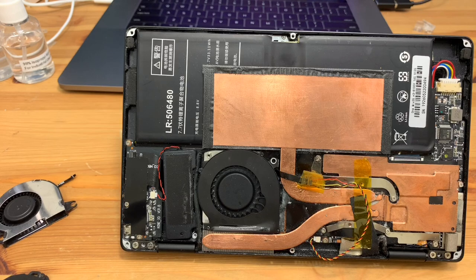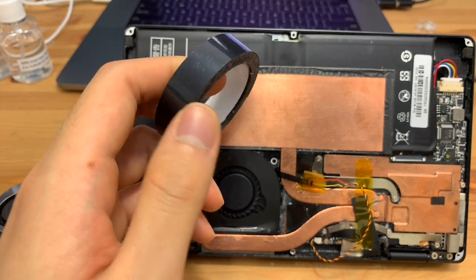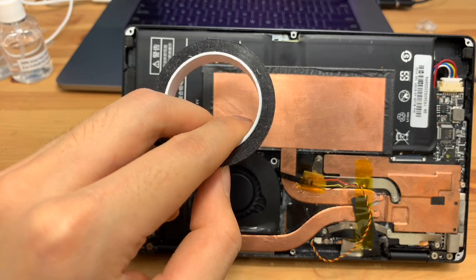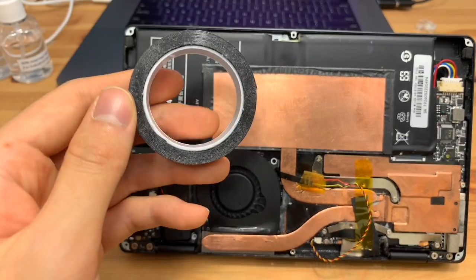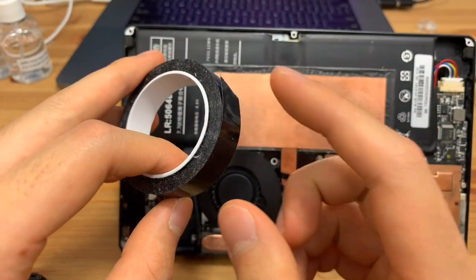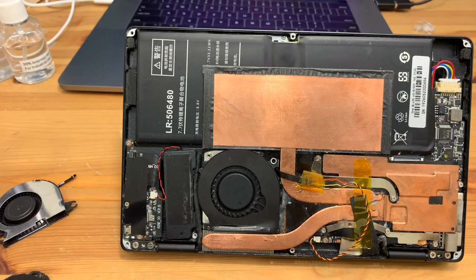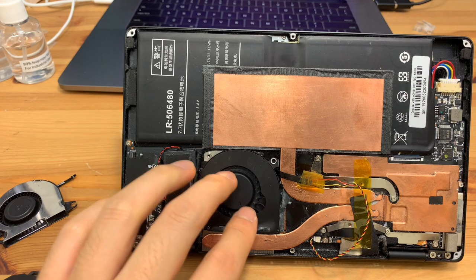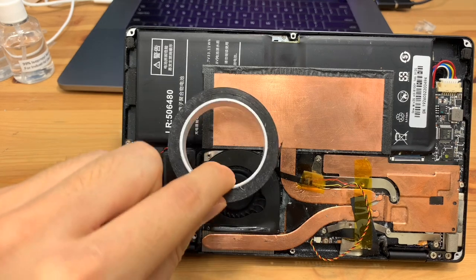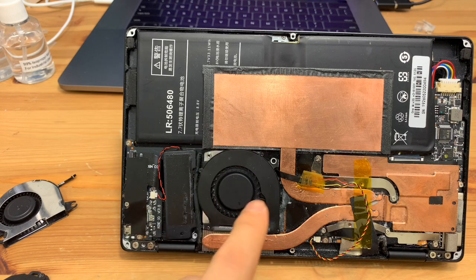In order to hold the fan in the computer, I got this tape off DigiKey. This is 3M VHB 5962, was it? I'll put all the information in the description down below because I can't remember right now. But this is really sticky tape. It's really good. It's designed to stick LCD screens to phones. So I just used a bunch of this underneath that fan right there. I didn't put any on the flex cable, of course. Just between this area. And this stuff is very, very sticky, and it becomes stickier over time. So I'm confident that'll hold the fan in. No need to use screws or anything.